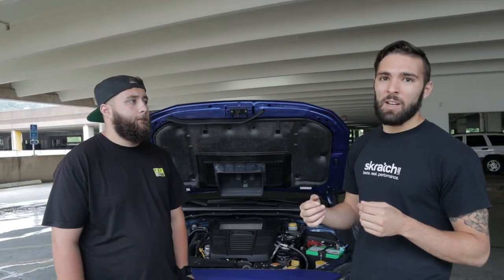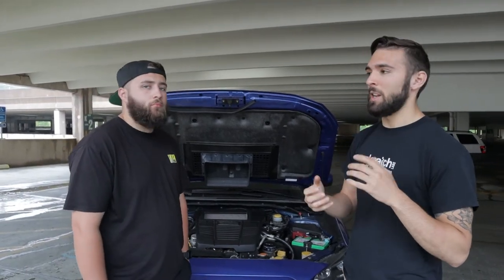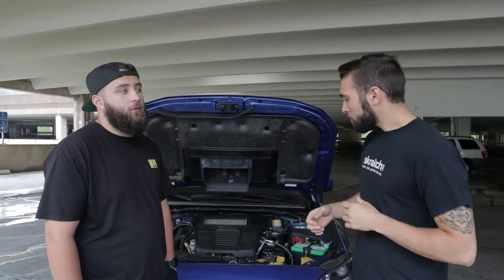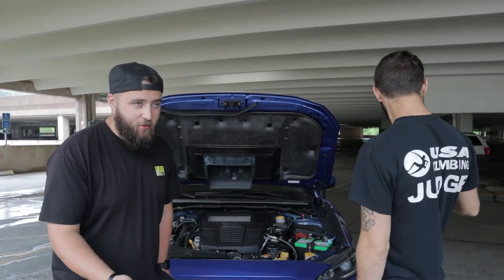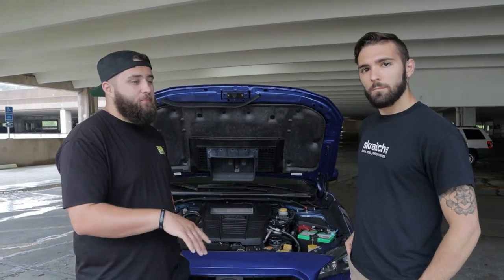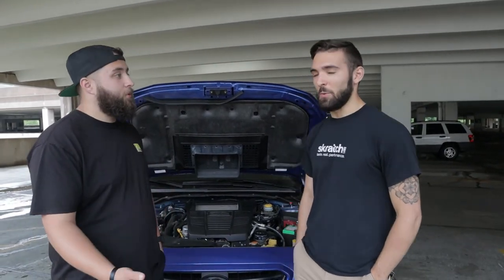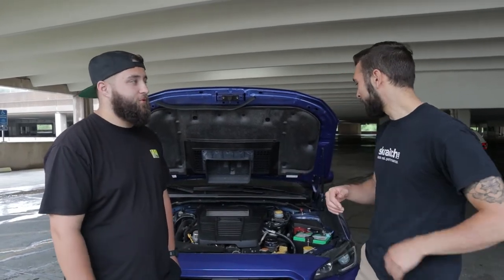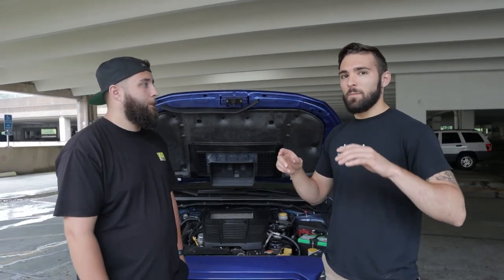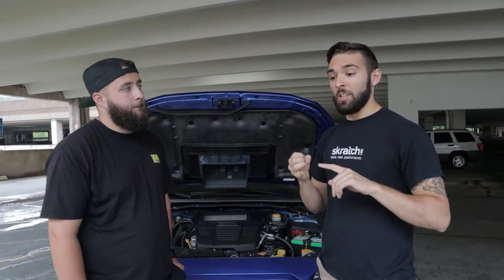For EGR, just put electrical tape over the connection so it doesn't corrode, and it's easier to undo if you ever need to return to stock. I recommend saving all your stock parts, especially if you're not keeping the car forever. That way you can put it back to stock when you sell it. Last thing in this section: flex fuel and ethanol - go with Delicious Tuning or Cobb for the sensor. Don't get a cheap Chinese brand.